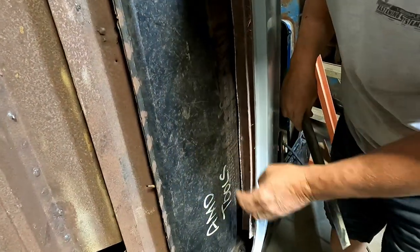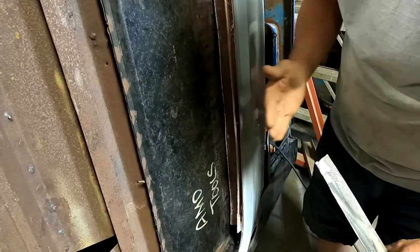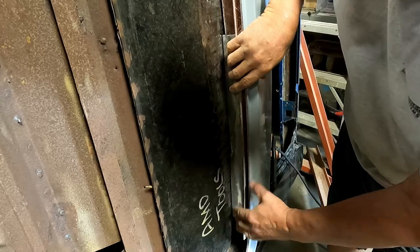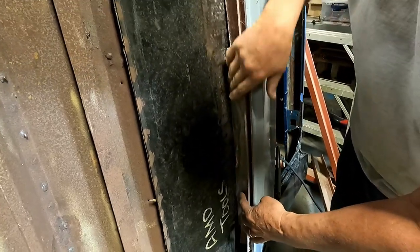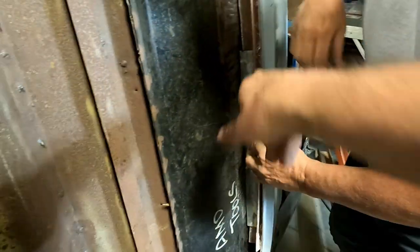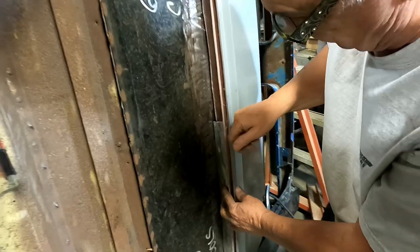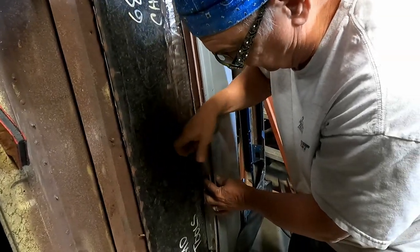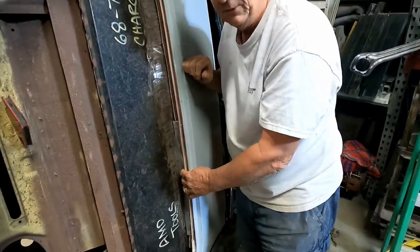We have this fiberglass lip, but you don't want this coming in and out. So the way they show is put these in here. They weld. So we're gonna hold that tight up against there and then put some tacks, and then when we bring that up, we'll drill holes and bolt that together so it can't come back up, because it's welded to the panel. Yep, sounds good to me. Okay.